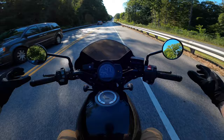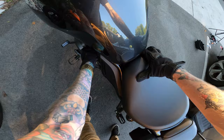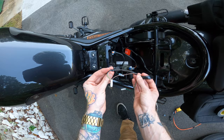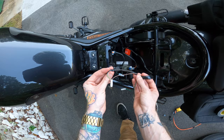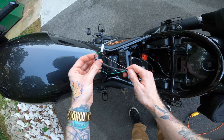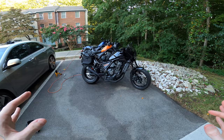Alrighty, moment of truth — hit the set button, and we are good to go! Cruise control is back in business. Turn on the turn signals and it's flashing at a normal rate — let's go! Test run was a success: we got cruise control and normal functioning turn signals. Now we just got to heat shrink this and tidy everything up. This is what it'll look like once you're done — heat shrink in the middle shrunken down as far as it'll go, and on each end we've got electrical tape for added security to make sure we're all sealed up nice and tight. I'll slide the casing all the way back up and make it all clean with some electrical tape wrapping up through here, then plug it back in, put the storage box back under, seat back on, and we are good to go. Just a couple of butt connectors and some heat shrink — no soldering required.